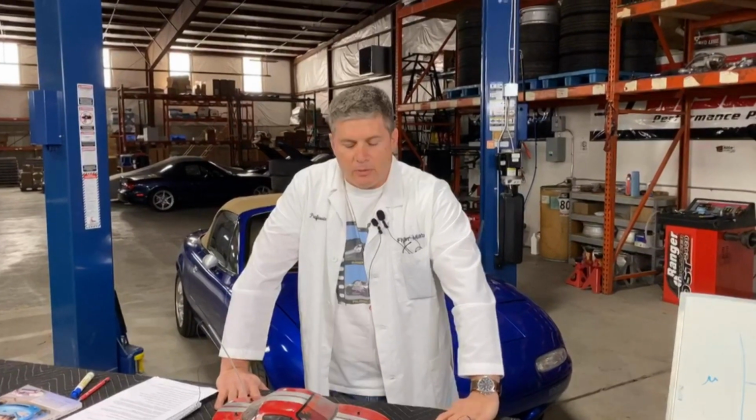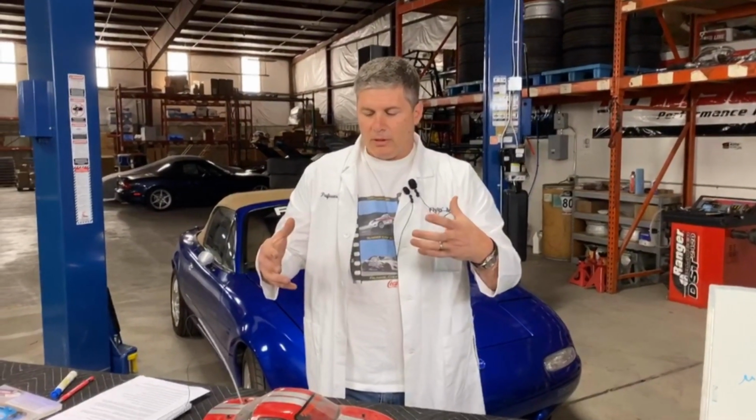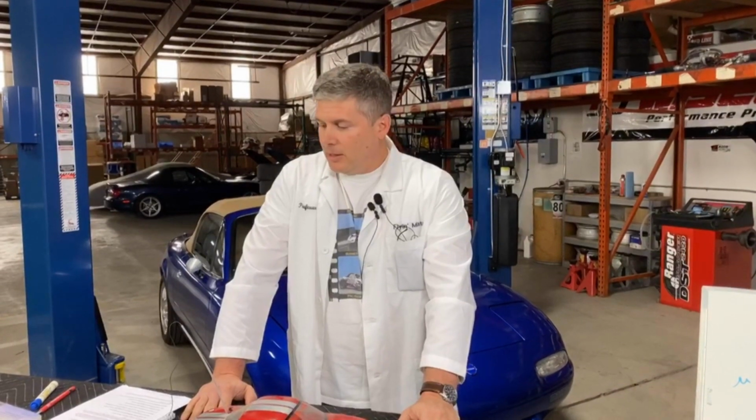Most of the big brake kits also have the advantage of being much easier to change pads, so if you're running one set of pads on the track and one on the street, you can easily swap back and forth. They may come with more pad sizes available, and being aluminum, they do shed heat a little better than the cast iron calipers that came in the car. They tend to be stiffer as well, so you might get a better pedal feel, and they're lighter. Again, like we were talking about with the Brembo thing, they are lighter than what you might find from the factory. But really, if you're looking for a 100% functional answer, the answer is heat. Can your car handle the heat for what you're asking it to do? And where is that line?